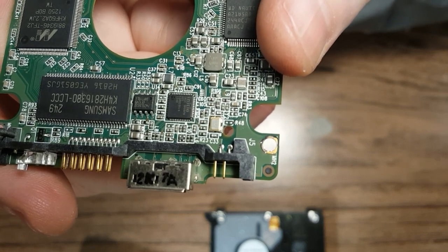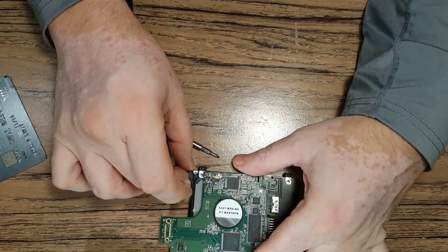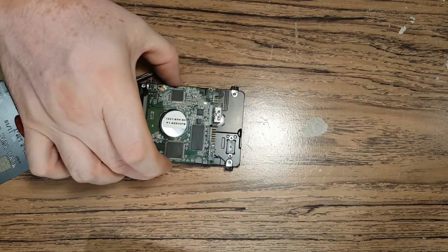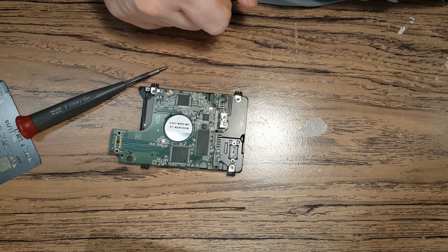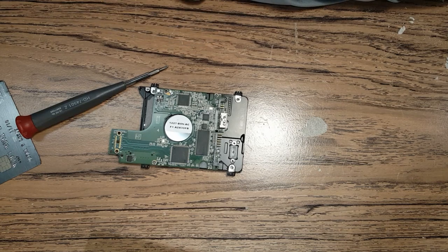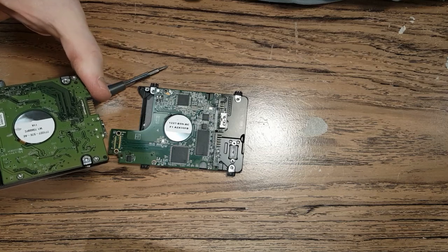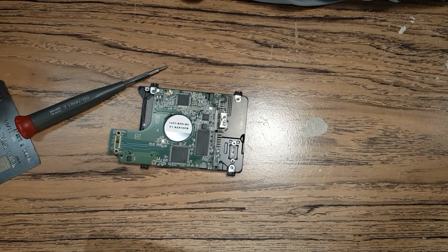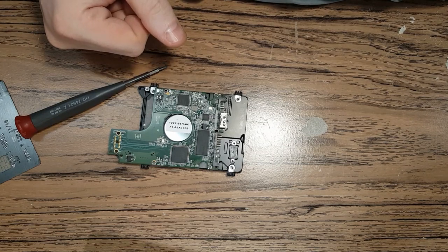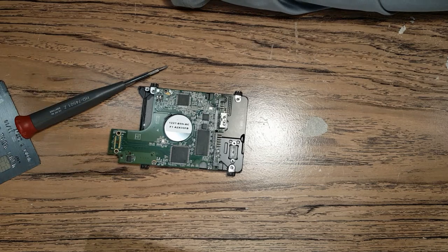This is part one of tearing apart the physically damaged drive. If you have any questions, please ask down below. If you'd like to subscribe, please do. I will be putting out part two — a more lengthy video on how I actually got the connectors reconnected — and we'll see what goes. Before I go, I do have a donor drive that is very similar. From experience, you cannot simply swap the circuit boards on these newer drives — they're coded on the inside. On some older drives you can do that, but on newer drives, unfortunately, you cannot. Thank you for watching; please subscribe and have a good day.